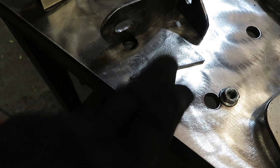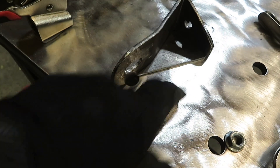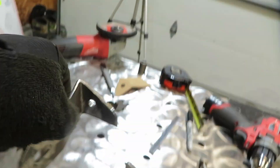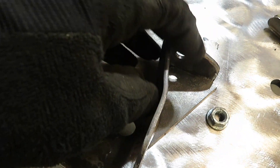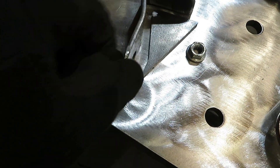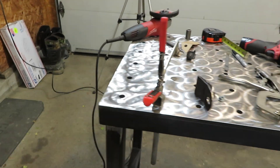This is what I came up with — I made a cute little gusset to go in there too. I still need to take it out to the truck and test fit it before I weld that gusset in there. I've got a flange head nut and I am going to have to weld on that backside because there's not going to be enough room to grab a hold of it and get it tightened up. After I tested it, I did go over 90 degrees and then kicked it back. It's now raining so we're going to leave the camera inside. I was going back and forth from my vice to my table so many times — one of the things I want to do is make a mount so I can have my vice just fixed to my table.